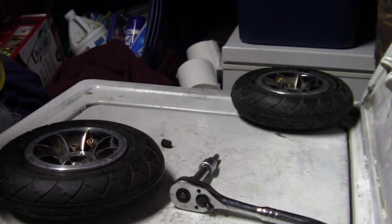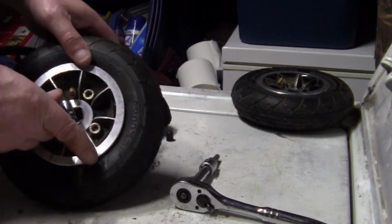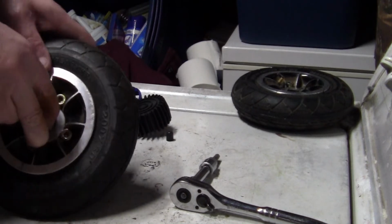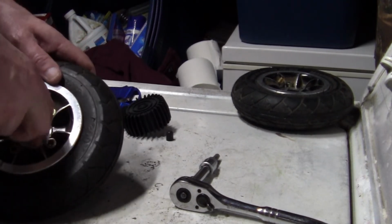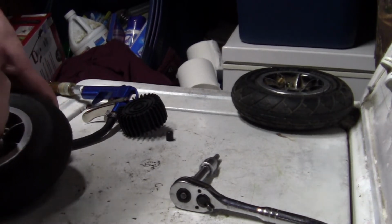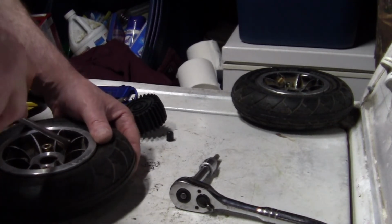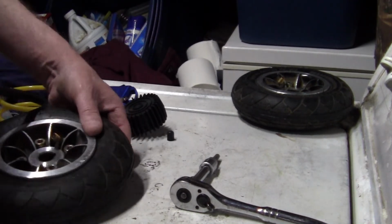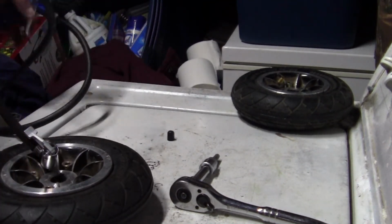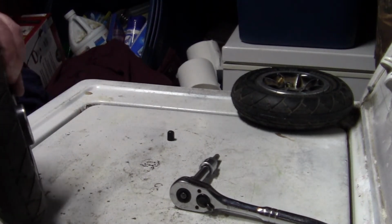And it's not like you're gonna be running your mobility scooter out in the brush, okay? So it's perfectly fine to put air up tires on it. And you'll save hundreds of dollars, literally. Shoot, missed that one. Get over there. There we go. Now we can air it up. Air it up slow because these don't hold much air.